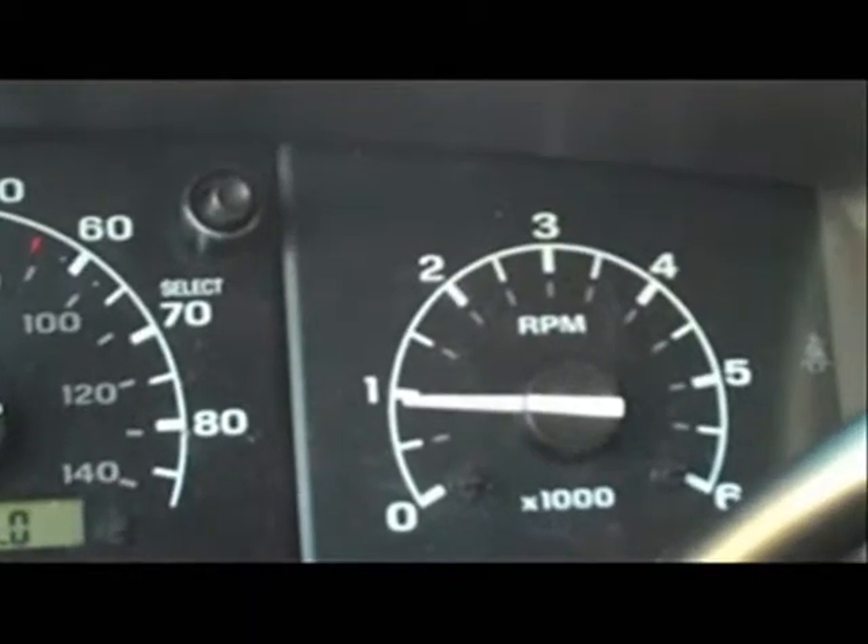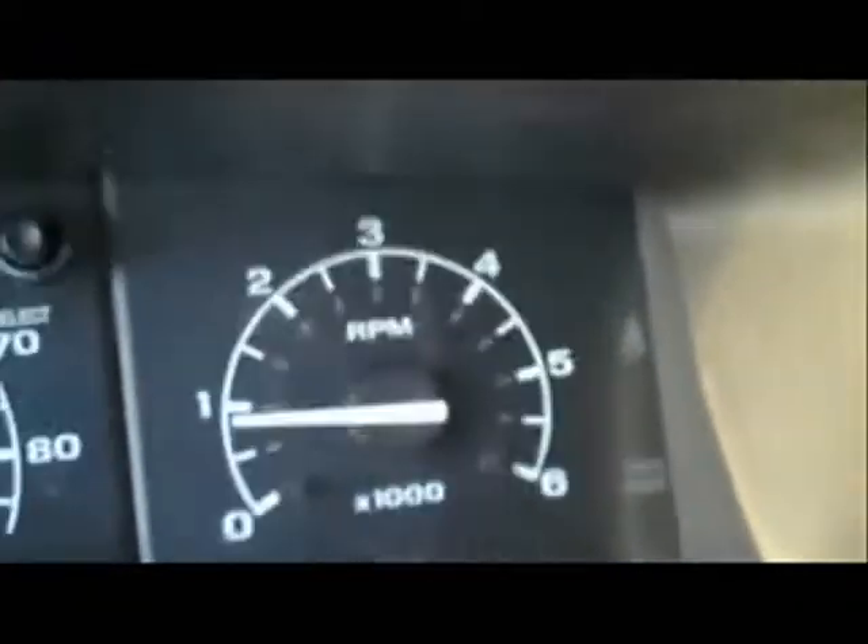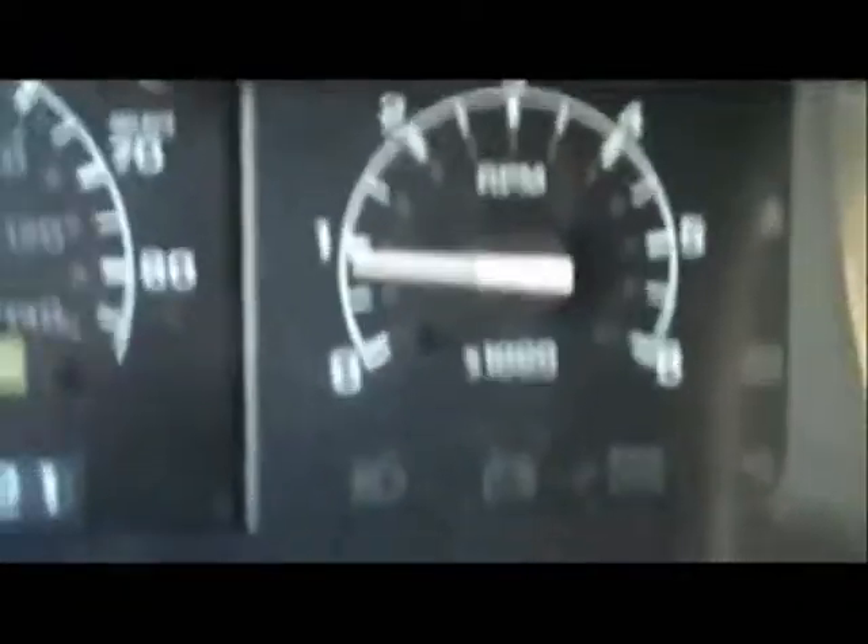Okay, so now... I had it out. You should have been able to hear the difference — it started going slightly higher. We'll take a look at the gauge now. The voltmeter is now down at zero because the alternator isn't charging. That will reduce the parasitic load on the engine and should get me a little bit better mileage. Not much, but if you combine that with all the other stuff I'm planning to do, that should get me up to where I want to be.